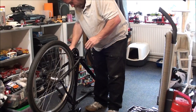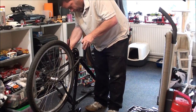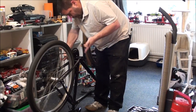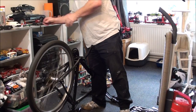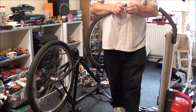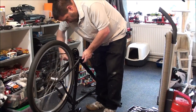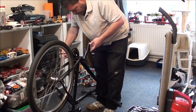It's not got much in the way of small sockets, but I've got socket sets for small sockets anyway. Let's just cheat and spin the crank. Keep holding those bolts and put those on here. Now we need the crank extractor too, which is just one of these. They can, on a rare occasion, come in different sizes, but for the most part they're all the same size and they should just screw in like that. Screwed in really nicely, actually.